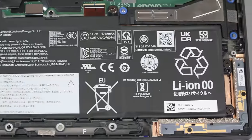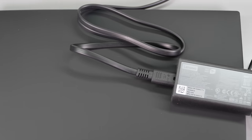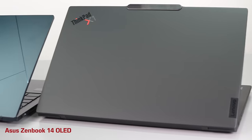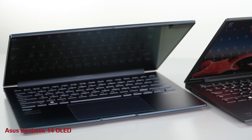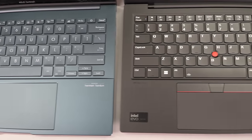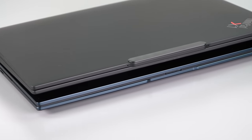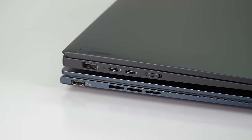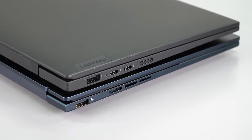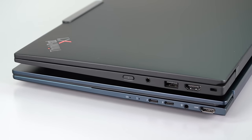There's a 57-watt-hour battery, and the included 65-watt USB-C compact charger is a decent capacity for keeping this thing light — they're not going to throw an 80-watt-hour battery in here. Battery life will vary. Most reviewers got the OLED model; the IPS screen would offer much better battery life given its lower resolution and non-OLED panel. For this OLED model with brightness at 200 nits and mixed productivity use, I was getting about six to six and a half hours — average for an OLED thin-and-light 14-inch laptop. Streaming video lasts longer; heavy Photoshop or spreadsheet work gives shorter run times. I'd expect about two hours more from the IPS display option.